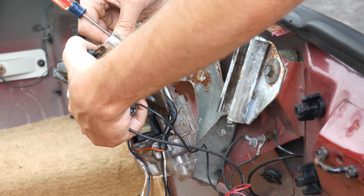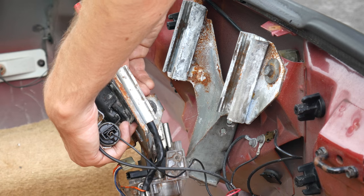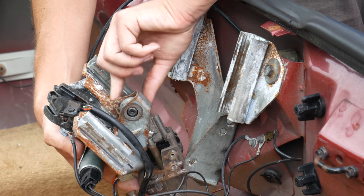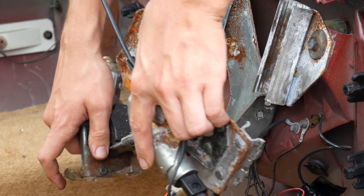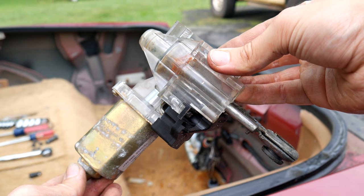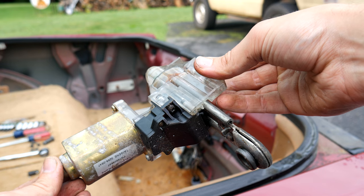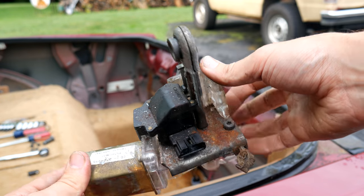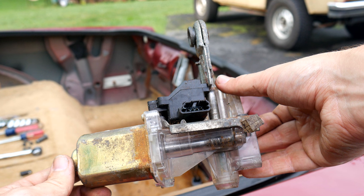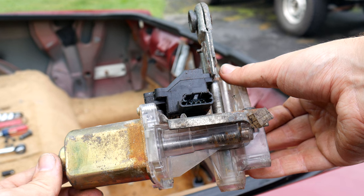The lift motor is held to the latch assembly by a pin which is retained by a spring clip. We'll use a small flat-blade screwdriver and work our way around the clip to pop it loose, and with the push-lock clip out of the way we can slide out the pin and separate the two parts of the assembly. We'll let the latch part just gently hang off of its release cable and take a close look at the motor. This plastic motor housing is another extremely common failure for these assemblies - all it takes is somebody slamming the hatch closed to break it, but ours were still moving sometimes and I'm pretty sure the issue is of an electrical nature.